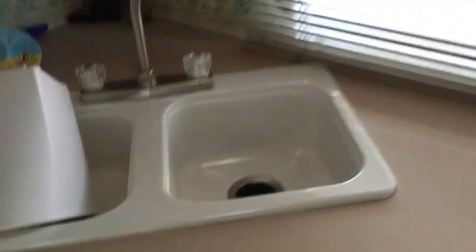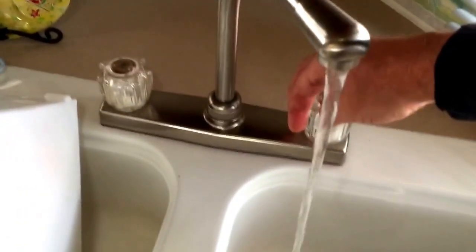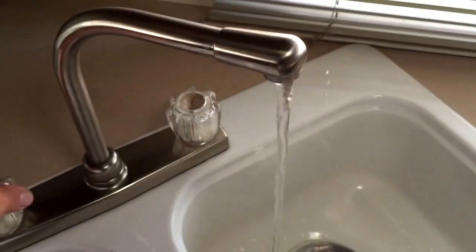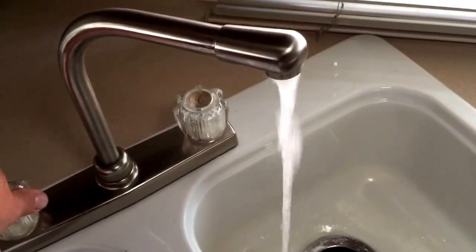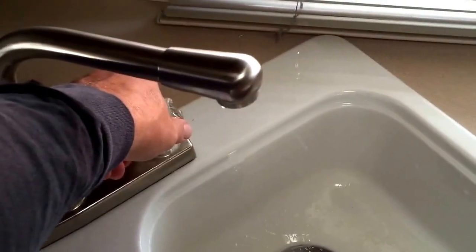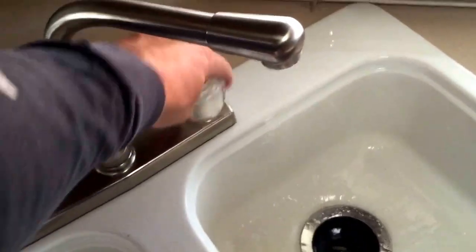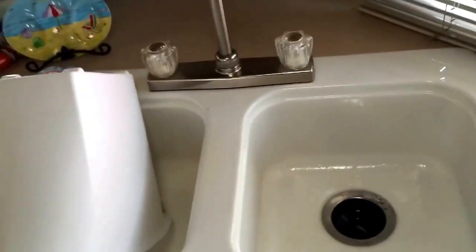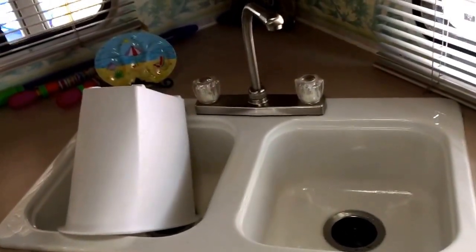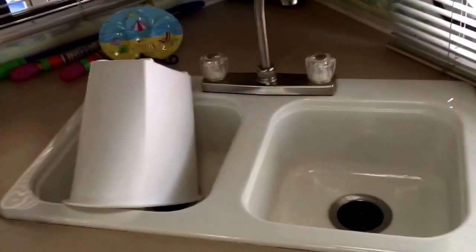Okay, I'm up front here — this is the kitchen. This is the hot side. That's how much water is in these lines. I'll do this several times back and forth, filling the lines with air and then coming back in here and opening them up until I get nothing but air out — no little sprinkles of water or nothing. Then I'll take antifreeze and pour it in all my drains. At that point, it's pretty much done.